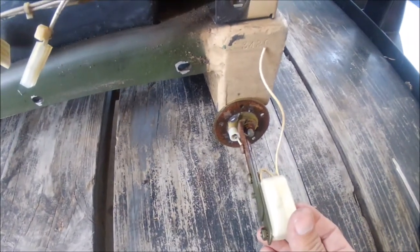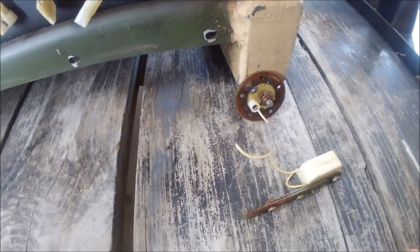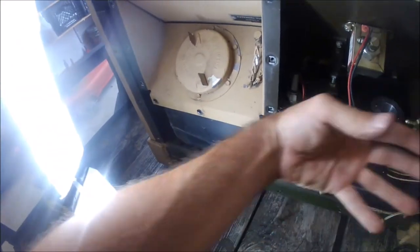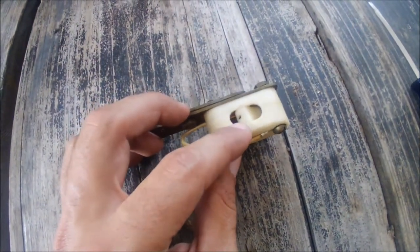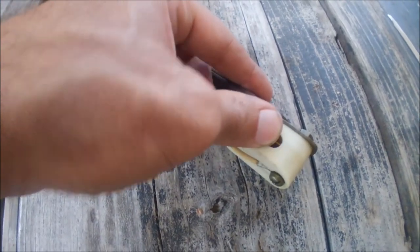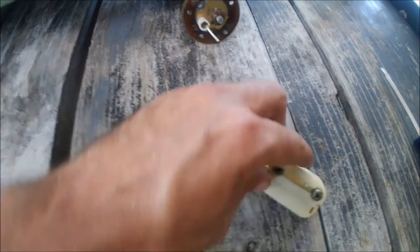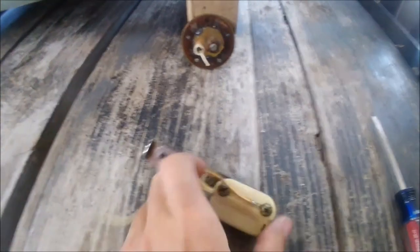The way it's supposed to hang - mine was broken. I cut this wire because when I went to pull it out of the top, the wire was dangling, it was stuck sideways, and the hole isn't very big so I couldn't get my fingers in. I ended up needing to open the tank, take the strainer out, and reach up to my elbow in diesel to pull it out. Also missing, probably still in the tank, is a bar that goes out with a float that goes up and down to give you a fuel level reading.